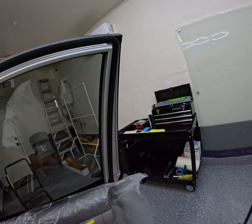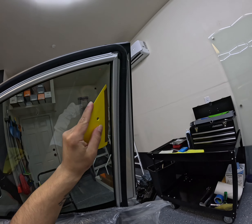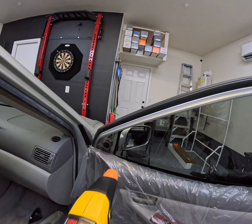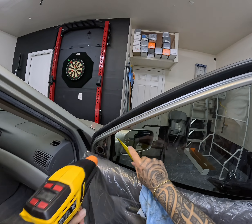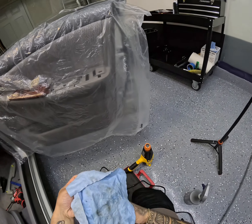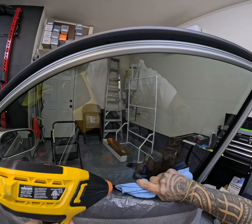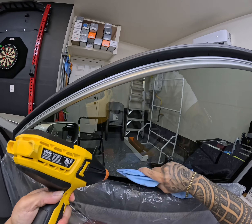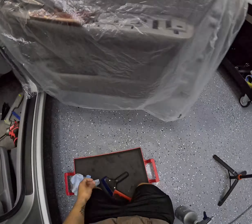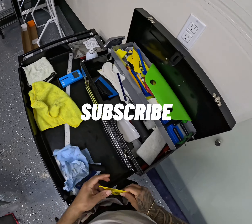Once you do the top, roll it up and do the same thing to the sides and the bottom of the film so it's heat sealed all the way around. After installation, check over your work to make sure you didn't get any hairs, lint, or fibers behind the film, or if you accidentally touched something while installing — it will look worse after it has fully cured. Chisel those out before you give the vehicle to your customer, and remember: no job will ever be perfect, but you want to make sure you're putting out quality work.